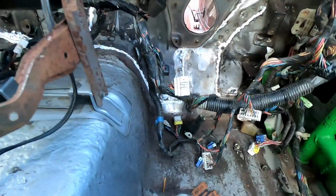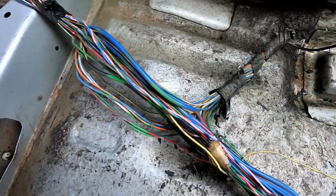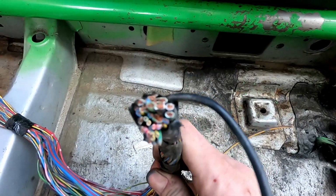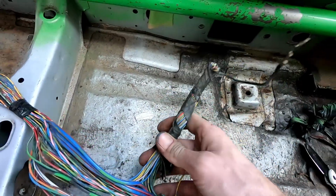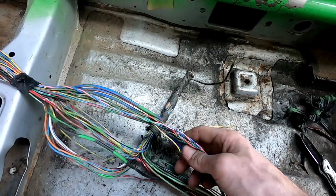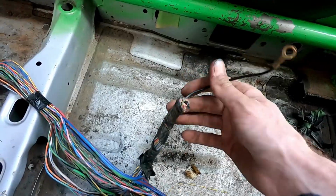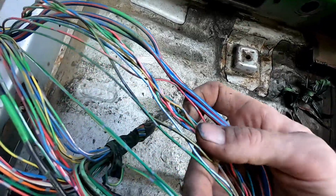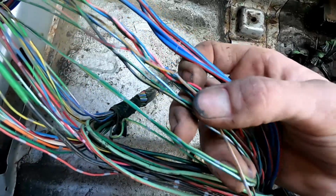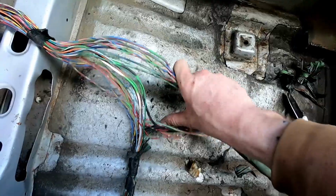Well, after spending about 10 minutes, we got the fuse box upside down, actually where it goes. Everything routed over, cluster stuff comes out the way it's supposed to. And we're going, and wait, what? Huh? The car was running and driving, had all the working lights, everything seemed fine. I don't understand what all of these must do, because I'm not familiar with 240 stuff. I do know I had this ground hooked up, but I'm guaranteeing if I undo this bundle, you can see this is all that really is hooked up is, what, 10 wires? Two big powers, it looks like, and then I see fuel pump wire and turn signal wiring. So if this is all I need and this isn't, this is all just garbage?